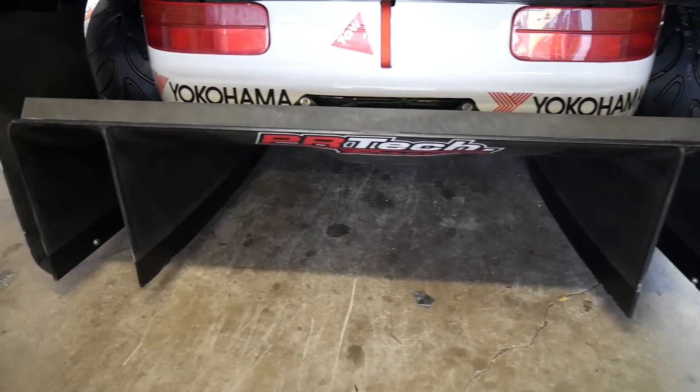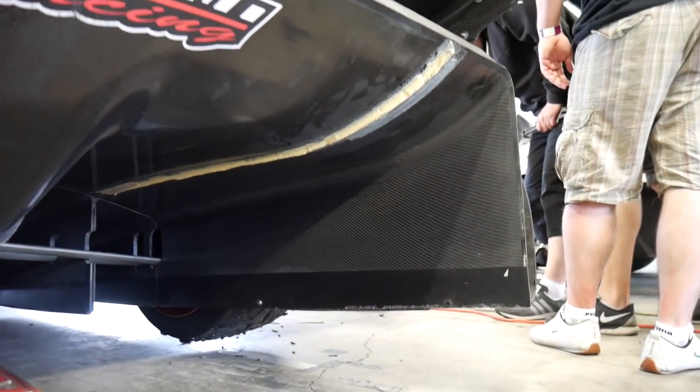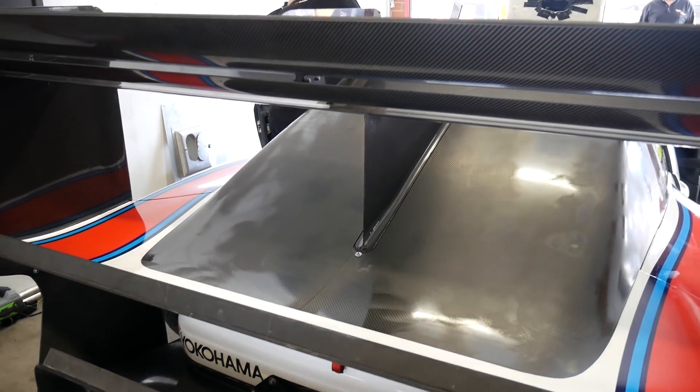Further down the car we have strakes in the diffuser — a two-strake design, quite wide. What's the logic versus more strakes or a strakeless design like the Aston Martin Valkyrie? The strakes divide the diffuser into separate channels, and by moving them further outboard we've tried to minimize the impact of rear wheel wake on diffuser performance, isolating that into a small section and keeping the center clean. At the very rear of the diffuser there's a kick inward from outside the tyre. Is this directing freestream air inwards or squeezing the tyre wake up and out? We want to keep the wheel wake above the diffuser rather than beside it, ensuring all that wheel wake enters and leaves the housing in a controlled manner.